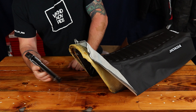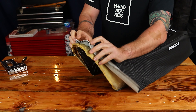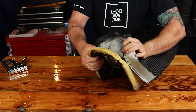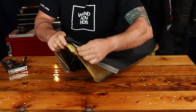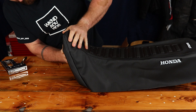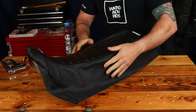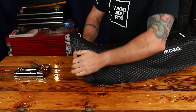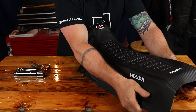I've got some quarter inch T50 staples in a heavy duty stapler. The first thing we're going to do is stretch the front portion over. I've got it turned inside out right now, just getting a look at how it's going to fit. We want to make sure we line up the center with this center stitch here and the patch that's on here. Then I'm just going to stretch it down over the top, making sure that we don't roll the foam backwards — we want it to roll forward over the top of the seat pan. I want to get all of the wrinkles out and I want it to be perfectly centered.